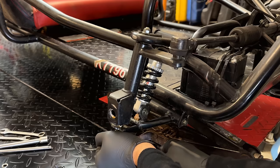And from looking inside the engine, I would say this is a bit of an upgrade. The other engine had a plastic camshaft gear. This one's at least metal. We have an oil sensor. The other engine didn't have that. And we have the same hole right there going through the crankshaft. So on the surface, I'd say things look pretty good.